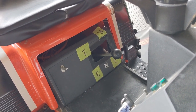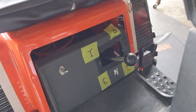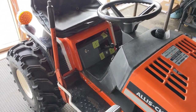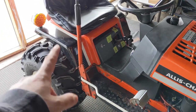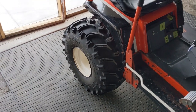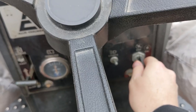And this is definitely going to help with plowing, because if he was putting that thing into second when plowing some snow, maybe he might try to plow some heavier snow with it in first gear, and it might do a little bit better because the engine is going to be spinning at the same RPM, but the transmission is going to be spinning slower, which will multiply the torque. And paired with these massive ATV bear claw tires, this thing must be a beast in the snow. So let's fire this thing up and take it for a spin.